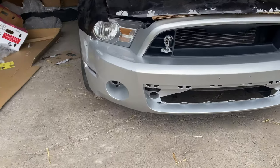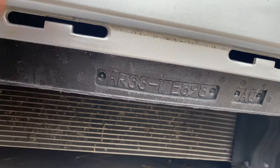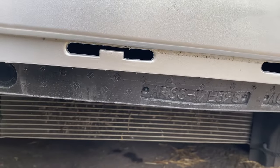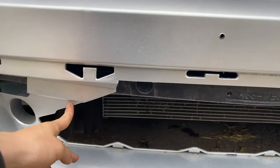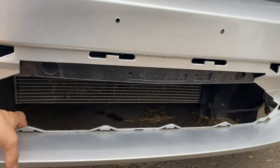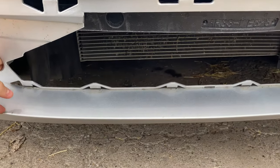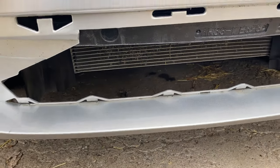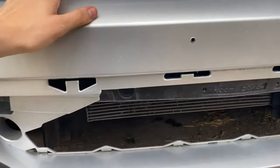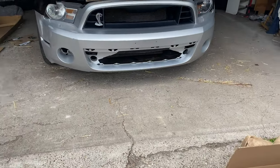The front of my bumper is shaped out a little bit because I'm using the factory crash piece right here, and what it could be doing is pushing against this and moving things up. It feels stiff up here but good right here. What I'm going to do is modify and cut down the piece of plastic that's rubbing on the cheaper part — which would be the lower grille — and see if that fixes it. If it does, I'll hook it right back up and continue; if not, we'll have to do some surgical work. It's just for myself so I don't really care about the bumper's condition — I'm going to make it work either way.